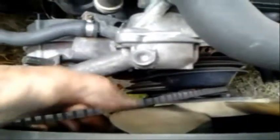Okay, so I loosened it up and the belt slid right off. And then, unlike the power steering belt, you have to get it around the fan. Once you do that, get that belt off. It's dual belts, so for this alternator. I don't know, ask Mercedes why, but I guess if you lose one belt, you still got one other one on there. So, next, we're going to free the alternator.